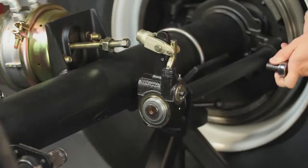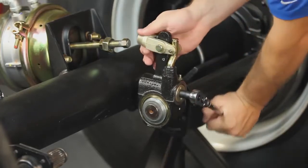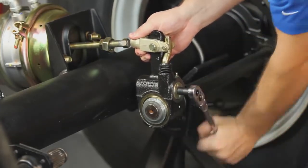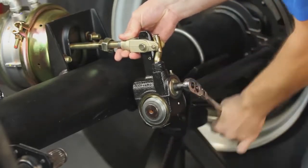Using a 7/16-inch wrench or socket, adjust the slack so that the collar nut aligns with the threaded area of the clevis. Do not use an air impact wrench, as it can damage the clutch.